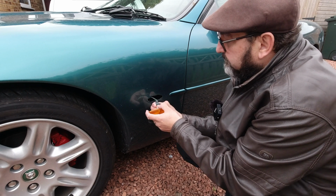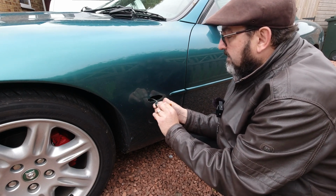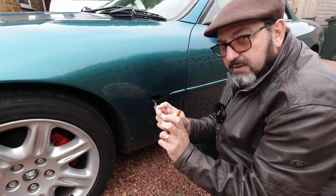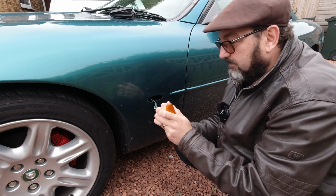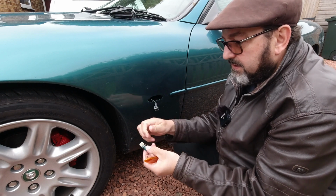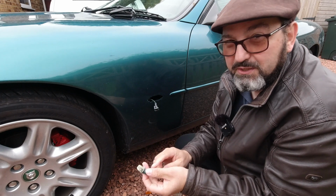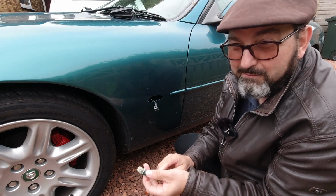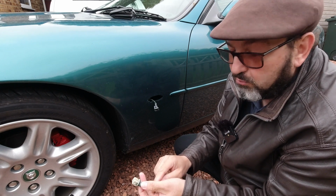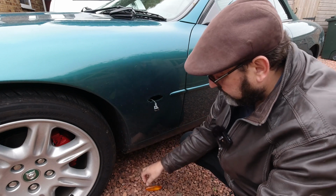Once this is out, you can disconnect the connector by just squeezing the metal wire again. Remember, you're going to need the bulb holder. That's a bayonet, so you just give it a little twist, quarter turn anti-clockwise, and it comes out. And in my case, swap the lamp from the amber lamp to the chrome lamp. These will have had clear lamps in.